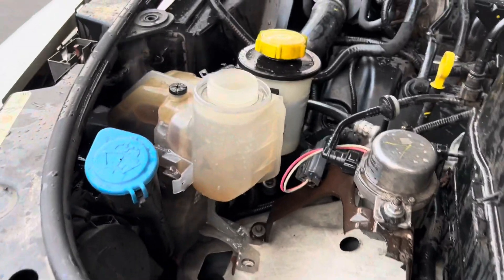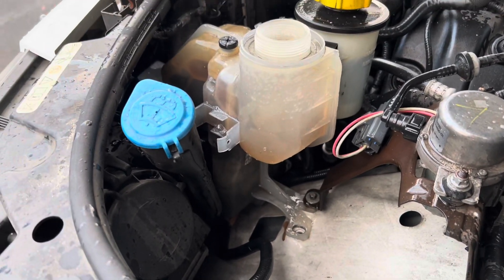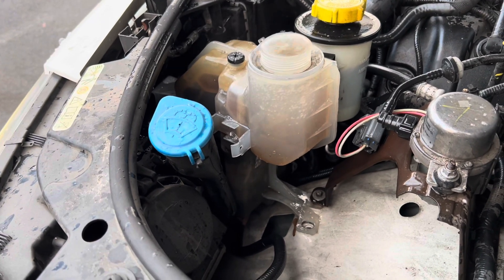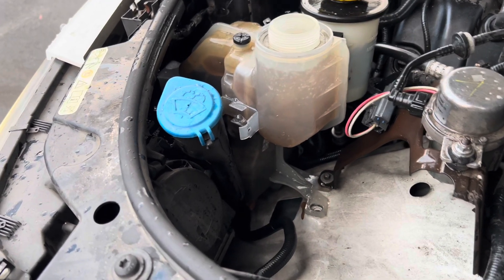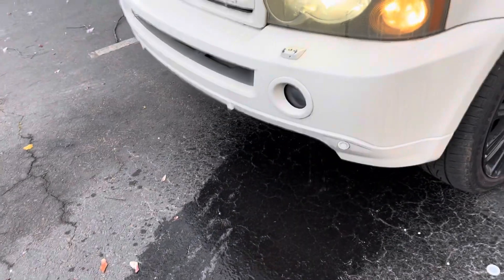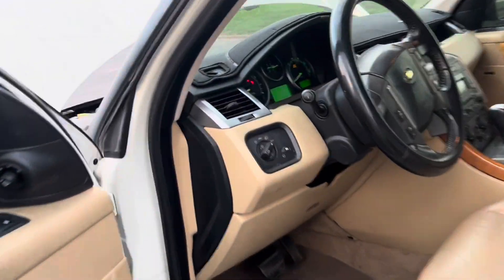Let's see what's going to happen. It's really bubbling, so I think the head gasket is pretty done in here. At least I know there's something going on — it's not just pressure related. It's a head gasket because it wasn't bubbling at all before. I'm serious, I was watching it other times I started it and it wasn't doing that at all. Let's see if the temperature is overheating bad.